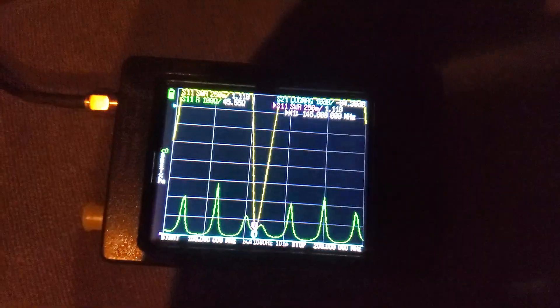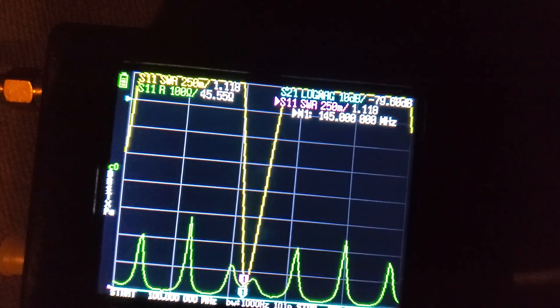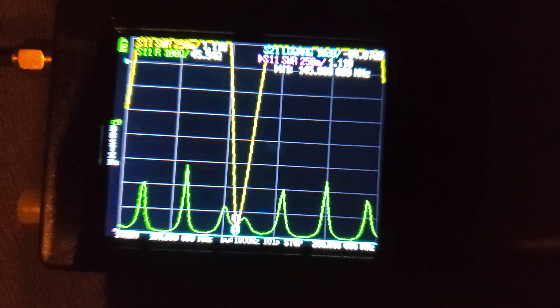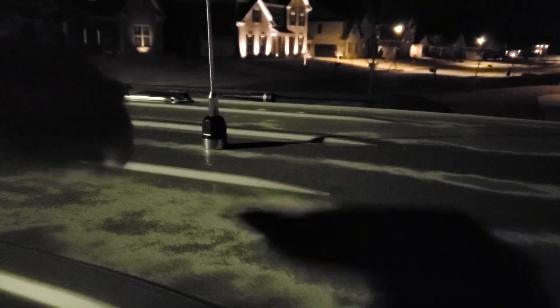It never got below 1 to 3. I just hooked it up and I'm getting 1.1 to 1 at 145 megahertz, right in the middle of the ham band, off of this Hustler CG144 2-meter high gain antenna. That's the best SWR I have ever seen on any mobile antenna, and it is solely because I actually put it on a proper mount.